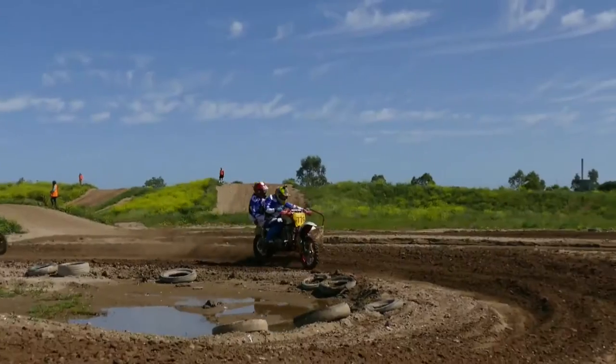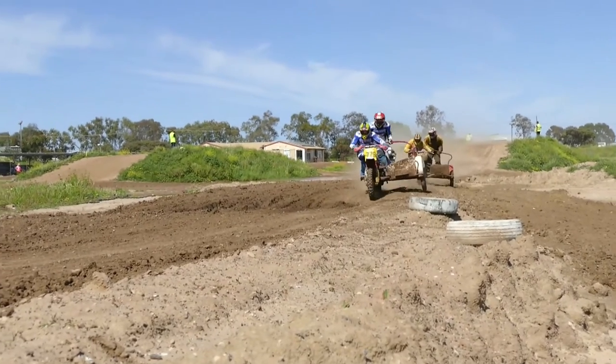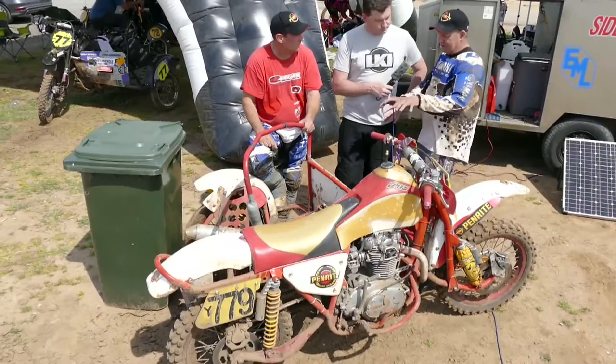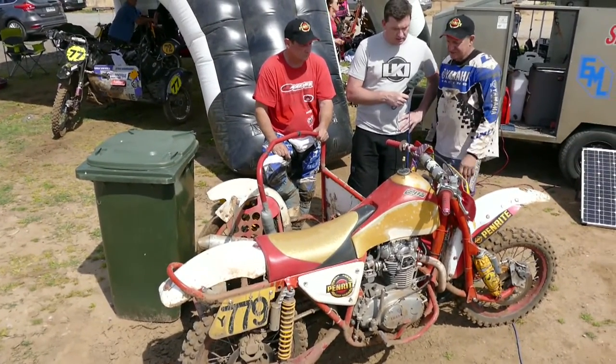How different is this from the Jumbos? It's heavier. They actually had airbag suspension and a torsion bar version for a while — EML tried a torsion bar going from one swing arm to the other, so it would tip in when the back wheel or sidecar goes down. The back squats with it so you don't get the walking effect coming down the main straight, which is a bit scary.